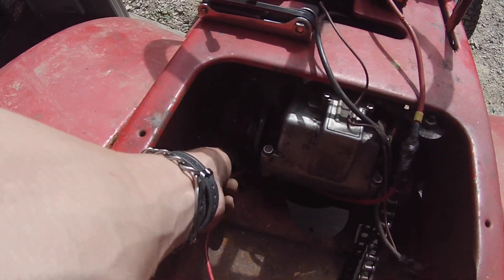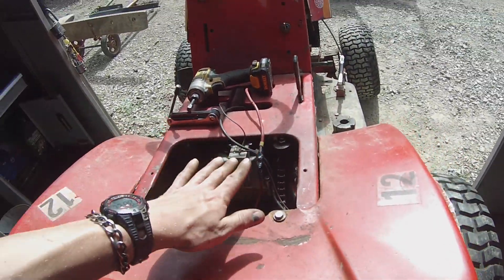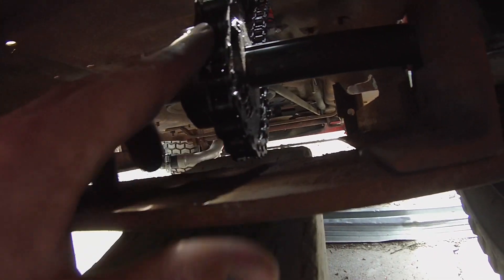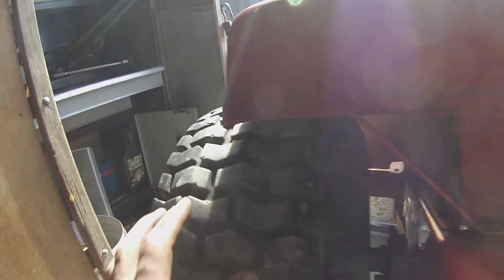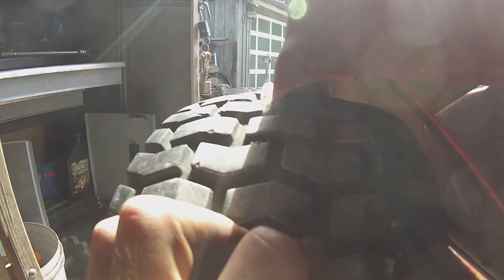Brakes are right there - they should work if I put a cable to it. I just put a washer underneath the transmission to jack it up. Over here, the sprocket clears with the 40 chain, and then I have my bearings here and no sprockets here. I'm going to upgrade these bolts eventually, but for now that's it. Since it's been lowered one inch, these fenders rub - I cannot even move the wheel.